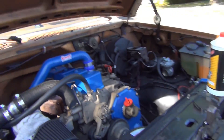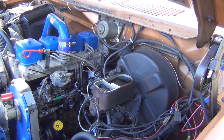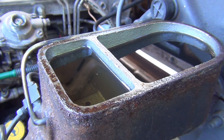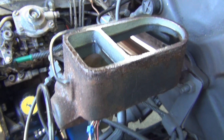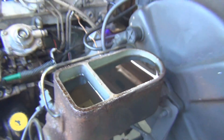I guess the truck is happy about its new engine — it's like, hey, I'll just help you out with your brakes. I'm going to go close out the other side and put my catch thing on the driver's side. Since I've got so much brake fluid, I'm going to go ahead and do the front wheels too — if I can get that bleeder screw open, I'll flush out the front brakes. After just a couple minutes of letting the other side drip and then going to the driver's side, we're down a little bit. I'll top her off and see if I have a brake pedal.